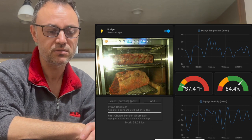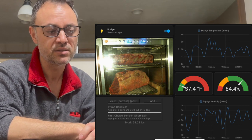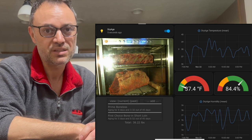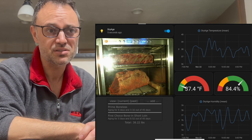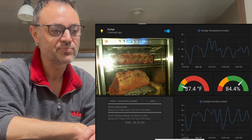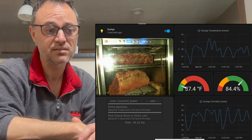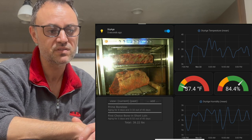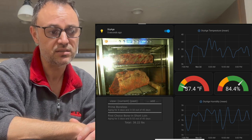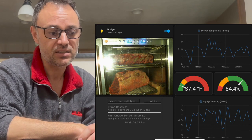When the probe froze, the refrigerator thought the temperature was around 34 degrees, but the actual temperature was well above 40 — it got into the 50s. A couple of times I had to stop what I was dry-aging, let it defrost, and deal with that. So I don't recommend setting the temperature at 35 or even 36. For mine, I found that setting it to 38 gave much better performance, and the temperatures actually stayed below 40 for the most part.